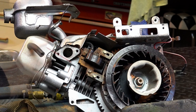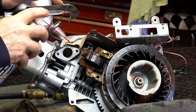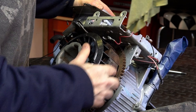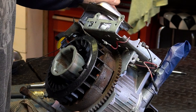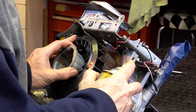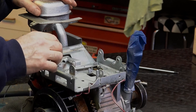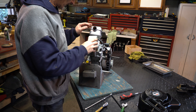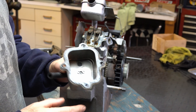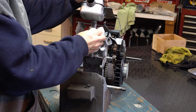Let me get a little bit of chain wax - this will keep it from rusting, which is a good thing because it's in the wet. Then come over here to where the magnet is - I cleaned it with the wire wheel. We'll get some on the gear. Just going to put a little bit of chain wax there. Alright, so while the cover is off we'll get to the valves - I'm going to take a peek in here. It's not too bad, there's some moisture - we'll blow that and wipe it off. But it's not all rusted, just a little bit of dirt.